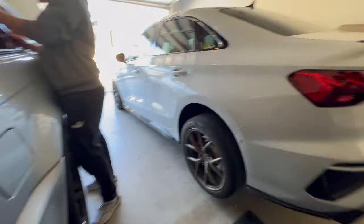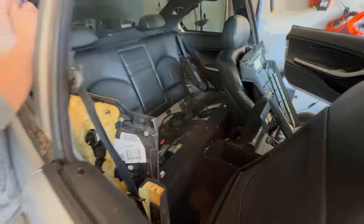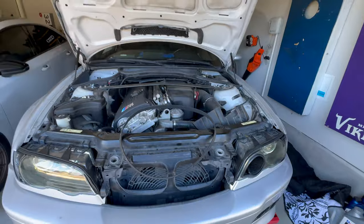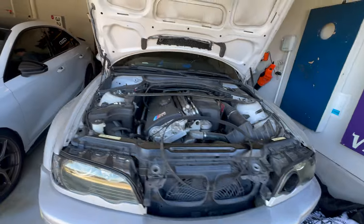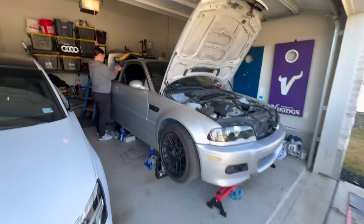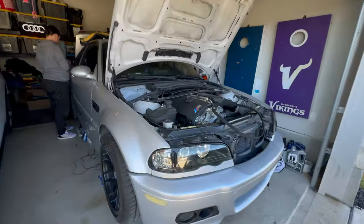We're out here. Car's jacked up. She's working on her stuff, I'm working on my stuff — getting this thing all together. I should have recorded it. We did a valve job on this thing. Went through and measured all the clearances and had to switch out some shims. And we did rod bearings on it. All types of stuff. Getting this thing all back to a prime gem. Got 180-something thousand miles on this beast and I still wish my car was this cool. Sounds and drives awesomely.